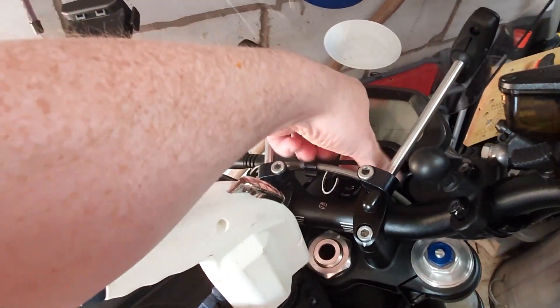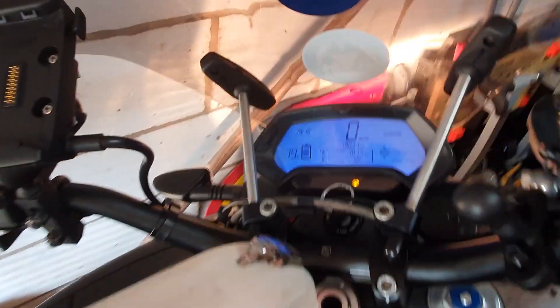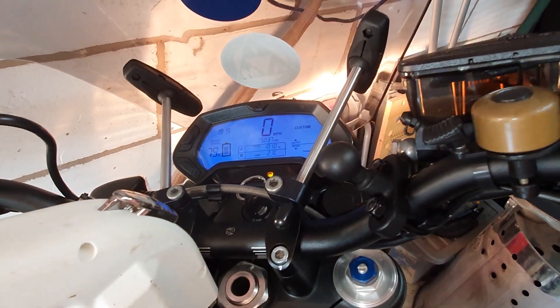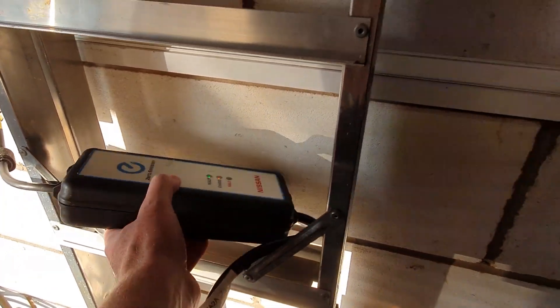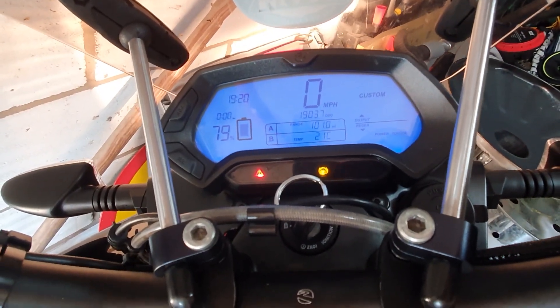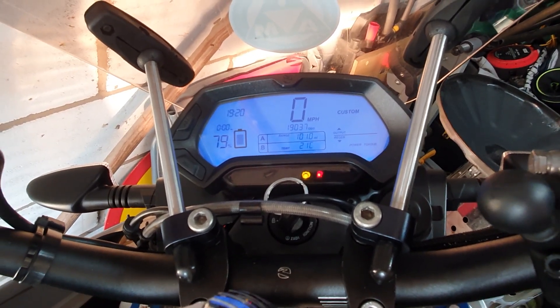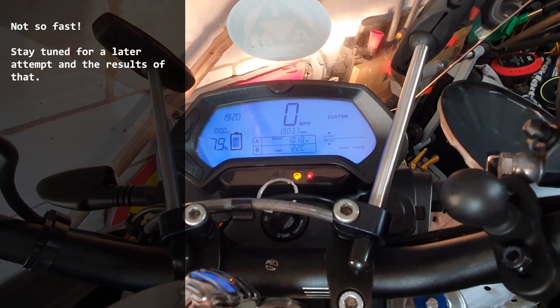So that's the plug in. What you've got to do to initiate the charge tank on the Zero is have the power switched on — it's at 79% at the moment. It's not charging; the contactor just went on — you just heard it click there — but it isn't charging. So I'm going to flick this switch and turn on the granny lead and we'll see how this responds. Okay, so that's saying charge and ready, gone orange, but this is erroring actually. So it doesn't look like that's going to work. That question's answered: it doesn't work. Nothing untoward is happening — it's just the Zero saying no thanks. Pity, that would have been potentially another useful charging strategy.